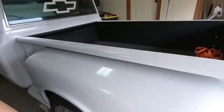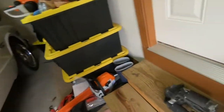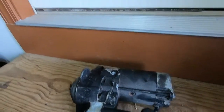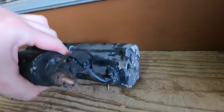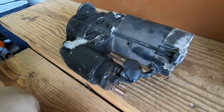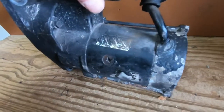Let me show you the starter. There's the old C10 — we'll get to work on it again soon. So this is a lot bigger than a gasoline starter. Diesels don't have spark plugs; they are compression ignition. I think this is probably our issue right there — this thing is just trashed. Funny it made it that long; everything on this is just super nasty and trashed. Funny it worked as long as it did.